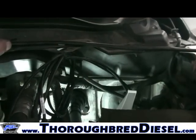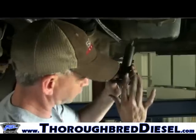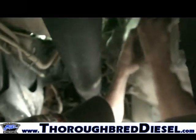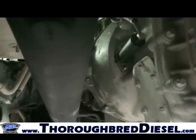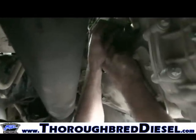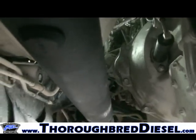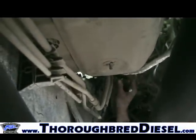Now we're going to do the slave cylinder side. On your slave cylinder, you'll have plastic locking tabs that hold the pushrod in. You don't cut these or break these — what will happen is when we attach this, the first time that we touch the clutch pedal that's going to break these tabs and disengage the pushrod. It's bolted to the side of the transmission with two 13-metric nuts. You'll want your hydraulic line pointing up — that keeps it away from the front driveshaft. We'll zip-tie it up everywhere where it won't make contact with anything in rotation like the steering shaft and the driveshaft.